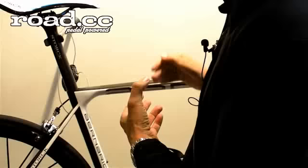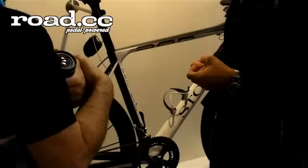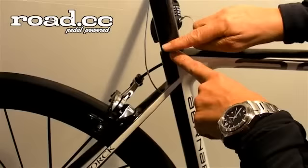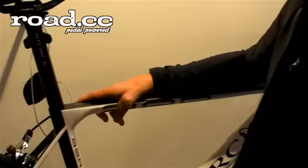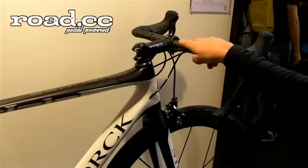If you want to achieve best of all properties like having stiffness, comfort, and aerodynamic, the seat post delivers you a very large portion of your comfort. So if you have an aero post, you can't basically create that. But with this new seat clamping mechanism, we don't have the overlapping of the post with the seat tube, so the post gets more flex, plus we have the seat stays at the lower section, so it creates a much more comfortable ride for the bike as well.